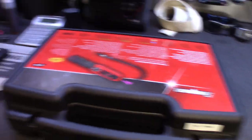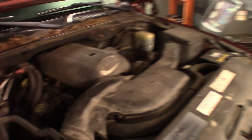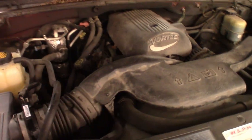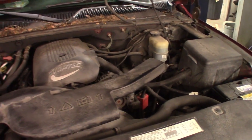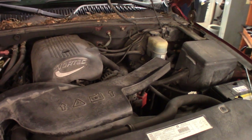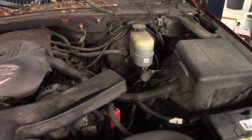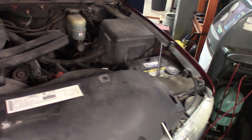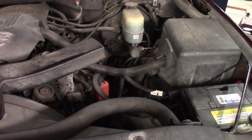I've already got the tools out here. Obviously you want to make sure — warm weather is coming — but you always want to do your preliminary checks. I did already put the AC machine on there, seeing if there was anything in there, and gave it a visual. I always like to try to find the leak visually first. This one was from last year — the customer set it up when it started getting cold. We know we've got a small leak, but I'm looking for some dye. I don't really see any dye stains or oil anywhere — checked up front and all that. I have an idea, I think I know what it is.